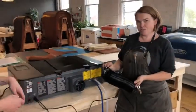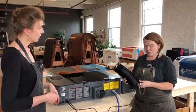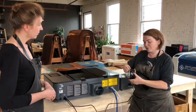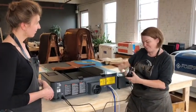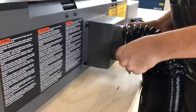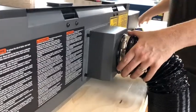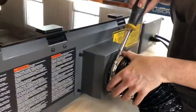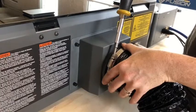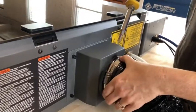Now we are going to connect the ventilation hose, and this works the same way whether you're using the filtration system or venting externally. You're going to want a hose clamp — put it on your hose, then slide the end of your hose over the shroud. That takes a little careful doing, so just be patient. Then using your slotted head screwdriver, tighten down the hose clamp. You don't need to crank it down totally, but you want it snug so the hose clamp holds the hose onto the shroud.